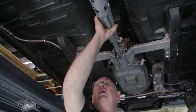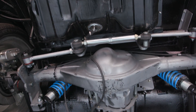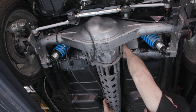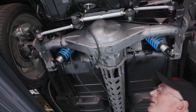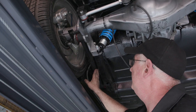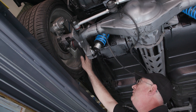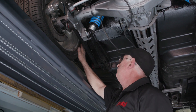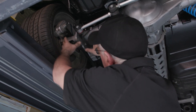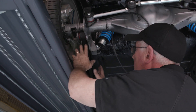The front crossmember is very similar. On this one we've incorporated an engine mount for the 6R80 transmission — that's an option available. The torque arm is slightly different, mainly for clearance to the floor; it's got a stepped flange on the rear. You'll see it's still got trailing arms the same as our conventional 3-link, however these are rectangular instead of tubular for clearance, so you can fit lots of big rubber underneath.